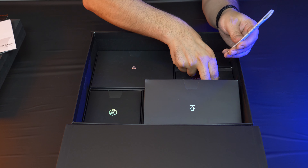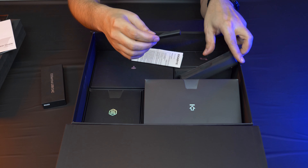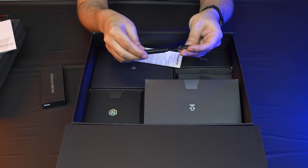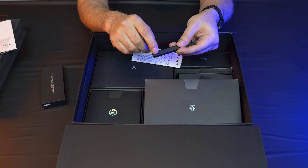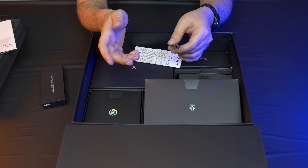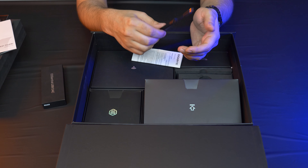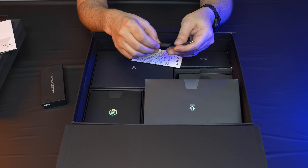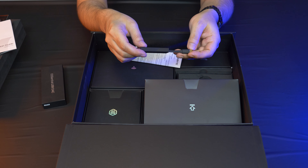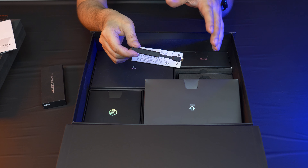The box also includes an Aorus USB DAC. It plugs into a Type-C header and has a DAC inside with an audio processor, nice capacitors, and really good filtering, so the signal comes out to a 3.5mm jack. I have a Samsung S21 without a headphone jack, and I tried plugging this in and the audio was pretty good. This should be better than what comes out of your front audio port, though this motherboard also has two separate controllers to ensure audio quality in both back and front.